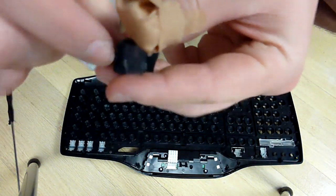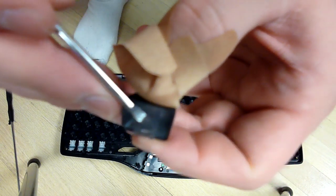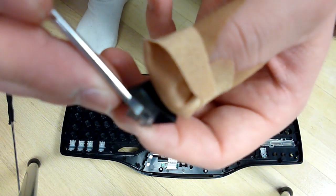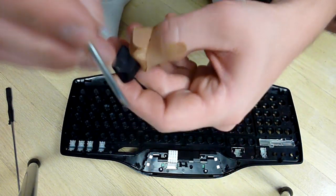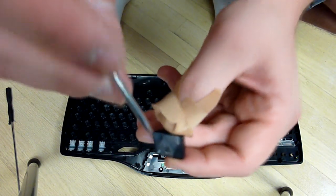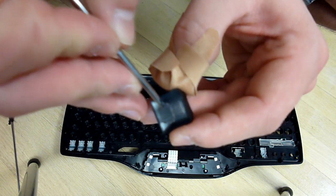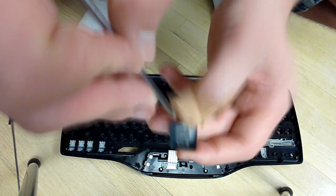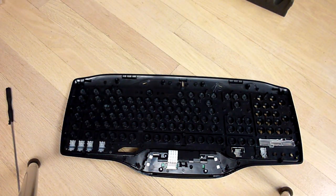So you'll see that there's this little plastic portion of the key, and it'll have two little tabs on it. One here, if it'll show, you can kind of see it there, and one on the other side. This is how they're held in. So what you want to do is take the tab of the flathead and gently push in on the tab that holds the key in, and pop one side out, and then pop the other side to take it out. So let me put my key back,